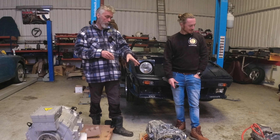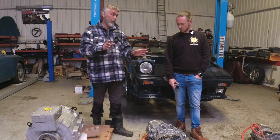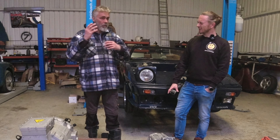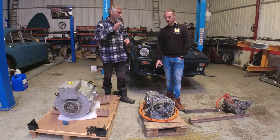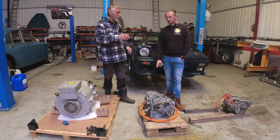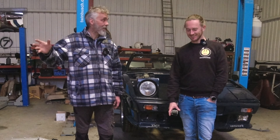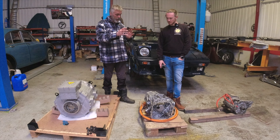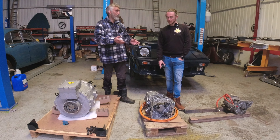The Tesla unit at 220 kilowatts — difficult to find accurate data on it — but as far as I can work out, it drops down to about 30 kilowatts if you have it flat out all the time. If you give it full beans for say 30 seconds, fine, but for a couple of minutes it will drop down and down. That's okay because you can't drive at full power for a few minutes without hitting 100-plus miles an hour very rapidly. By making it small and lightweight, it helps vehicle performance, and you're never going to drive it continuously at 300 horsepower unless you're on a track.